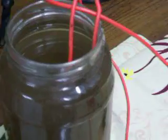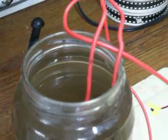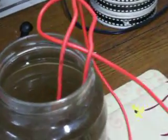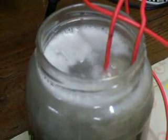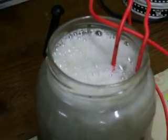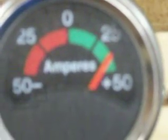Anyway, watch this thing. I'll kick my alternator on because at 40 amps it will draw the battery down quite a bit if you don't have something to keep charging it up. If you come over to the meter, she's hitting about 40 amps and holding at 12 volts.